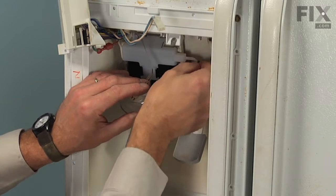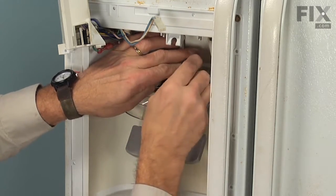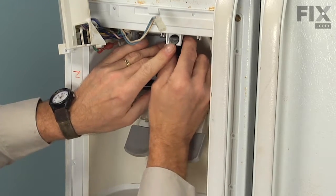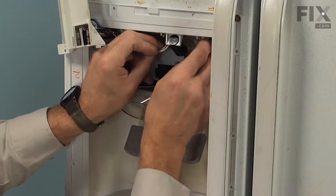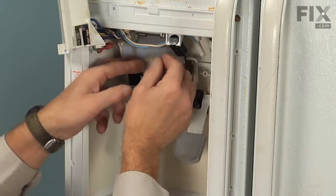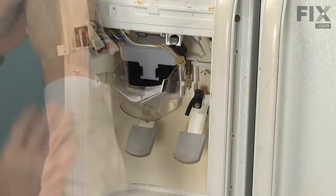And next we'll install the damper. Just hook that over the end of the support. Slide the barrel over that plunger and engage it in the bracket at the top. Route that white and blue wire harness in behind that, a ribbon cable over the top of it. And now we're ready to pull the assembly down in place.